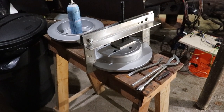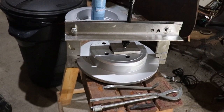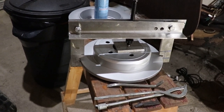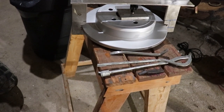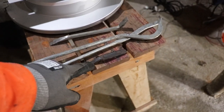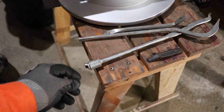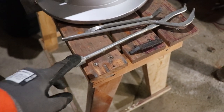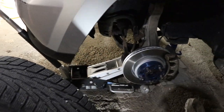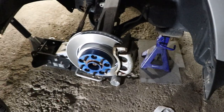Here's a brief additional introduction for the rear brakes. I've got a custom-made puller for pulling the back drums off — there'll be a build video on my channel for that. There are also a couple of tools I didn't mention earlier: tools for adjusting the back parking brake shoes, and a universal spring tool for drum brakes. I'll also show you re-torquing the wheel spacers — I already did one side and it moved a little. Set to 90 foot-pounds.